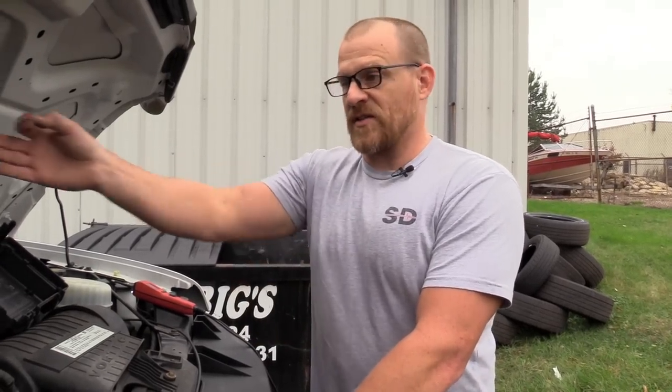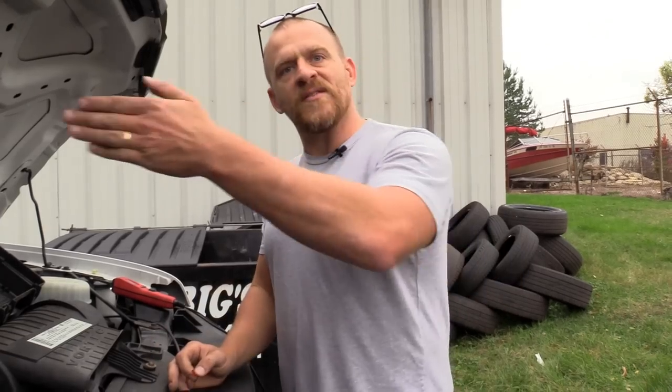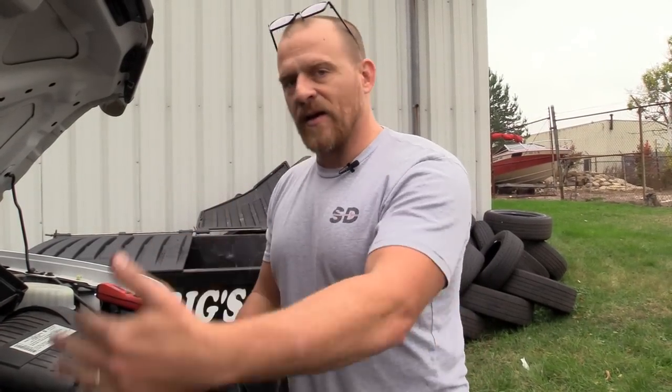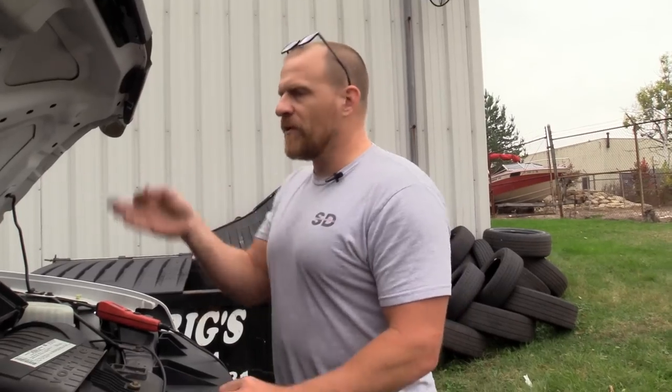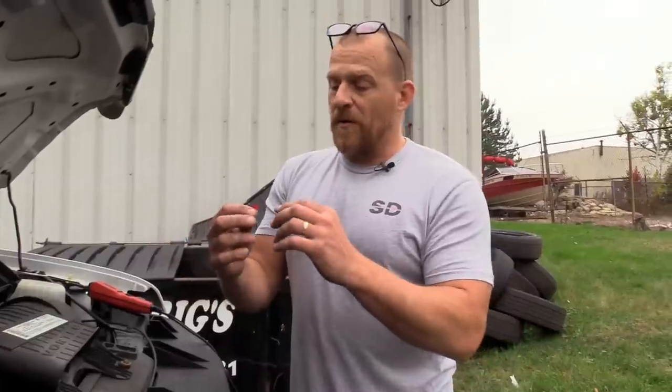Good question, Caleb. The problem is I'm not happy about it because that means our job just got a little bit harder. It might be one of those where we don't know why this fuse blew. And obviously if it's the left turn signal circuit, that's where our focus is going to be - putting this thing up in the air and checking the harness as it runs down along the frame. Which we are not doing today. This is really just going to be a lesson on why you need to check powers and grounds. Who would think a blown fuse to the BCM would cause the right rear turn signal only circuit to not work? The problem could be back at the bulb itself - but that's where I would start. Maybe we'll do an inspection on that socket.